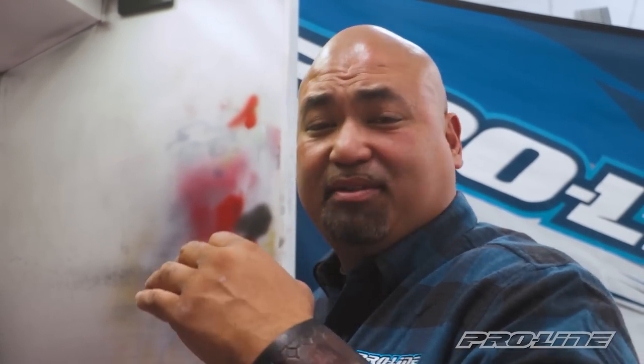So I'm gonna spray direct from the bottle and see how this goes. I'm probably gonna do about two coats tops on this. I'm not gonna go too heavy because if you go too heavy on the candies, adhesion becomes an issue sometimes. So you wanna spray it with the right coverage, but not too heavy or too light. Also, if your paint is too thick and you reduce it, just know that the candy paints have the least amount of adhesive of the other paints. So by adding more reducer, you could very well be taking out all the adhesion of the paint. So just be careful, use your better judgment and do test panels. I always recommend test panels because you don't want to start an experiment on your paint job and ruin it because you didn't test it out.